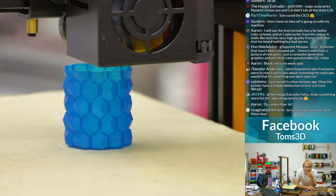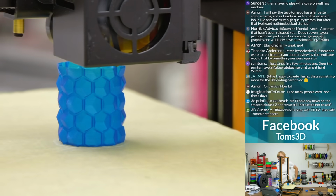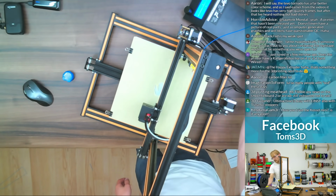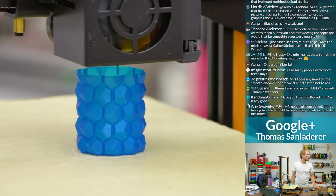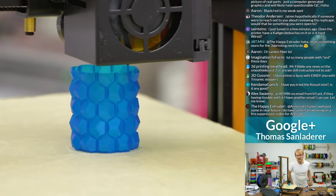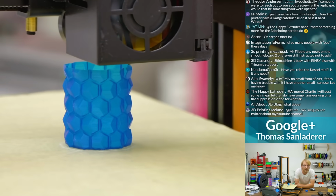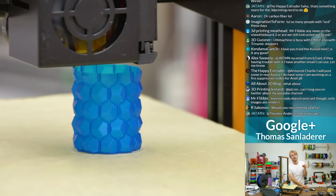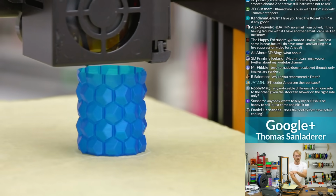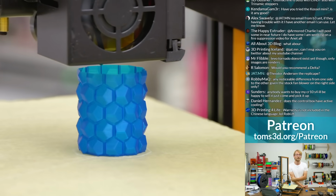Saint Eins is asking, does this printer have a Kaltgerätebuchse or is it hardwired? No, pretty much every printer has one. It's just slightly off frame, but yes, it has the regular IEC connector. It is technically a plug because it is a male connector. If you go on Gearbest and see the version with the wrong power cord being cheaper, just buy that one and get a new cord. They're like $2 and they fit, and the power supply is switchable from 220 to 110 volts, so it works anywhere in the world, even if you buy the wrong version out of the box.